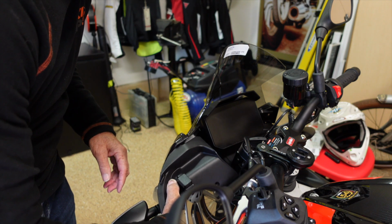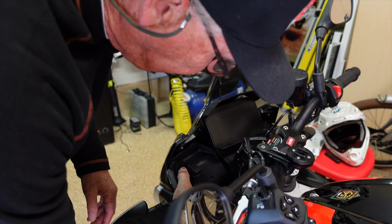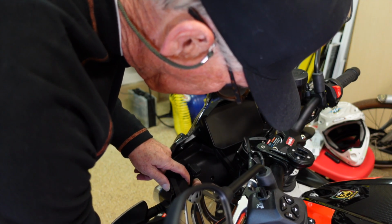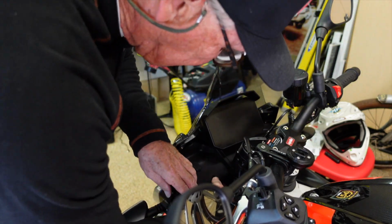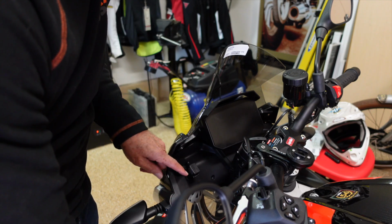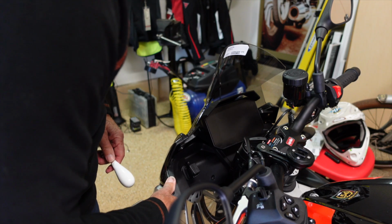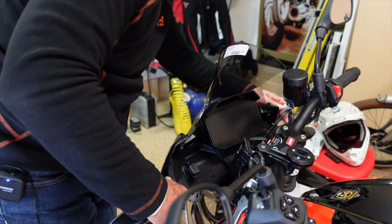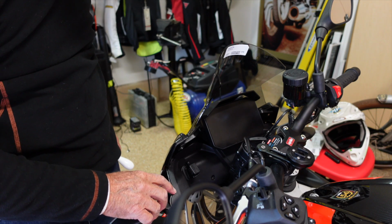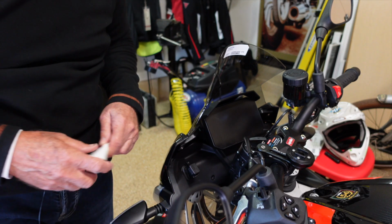Now we're going to put the fascia back in place. Yeah, it's going in. My camera's still running. Okay. Two more screws to go. Again, you don't need to overtighten those. And just check your gaps and fittings side to side, and see whether this goes proud or flush with this, and it's the same as on that other side over there.